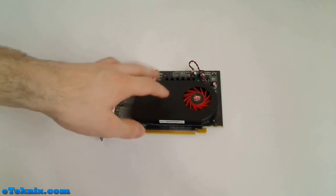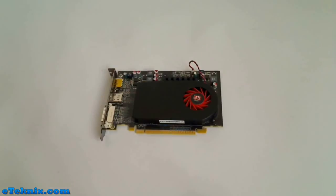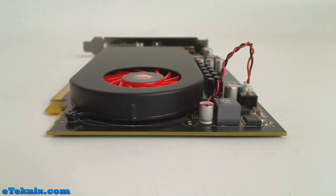Full specifications of the ATI Radeon HD 5670 include a core clock speed of 775MHz, 400 stream processing units, and it uses the latest DirectX 11 technology with shader model 5.0 and OpenGL 3.2 support. This particular card comes with 512MB of GDDR5 memory running at a speed of 1GHz, with a 128-bit memory interface. This graphics card uses a PCI Express 2.1 x16 interface.